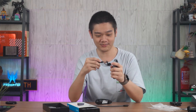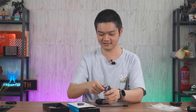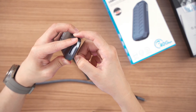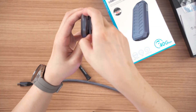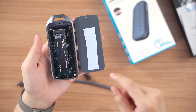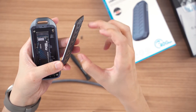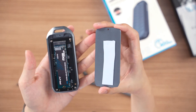So that's all we have to share about portable SSDs and why and how you should make them for yourself. I'm going to dismantle this and show you what's inside, since I need to take it out anyway. It's a bit difficult to open because the cover is essentially adhered to the SSD, so there's no clear way to pry it out. I finally got it open. As you can see, this is what a good SSD enclosure should look like — a swappable SSD in standard 2280 form factor, a thermal pad to conduct heat from the SSD to the heat sink, which is the enclosure itself. That is essentially what the inside of a portable SSD looks like.